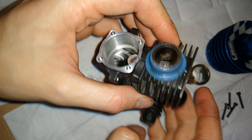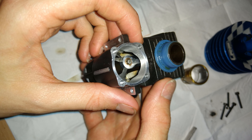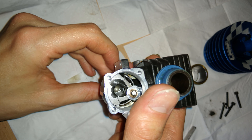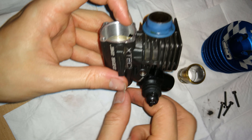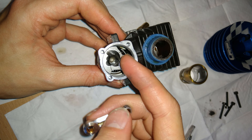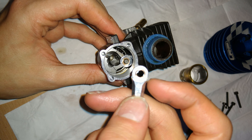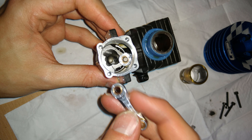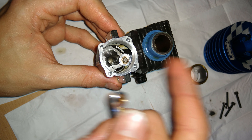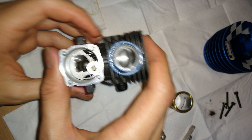Installing the connecting rod on this crank is hell. After a long battle I finally got it in. Look at the tolerances — you've got this big piston in the middle and the connecting rod sitting at a really weird angle to insert it. It really doesn't go in without a fight. You have to pull the crankshaft deep and use some weird angle to get it on. I could definitely feel the difference between the old and new rod — this new one was tight, which is what you want. If there's play on the bushing, eventually the bushing disappears, the rod breaks, and those shavings will scratch your cylinder and piston — then you basically need to buy a new engine.